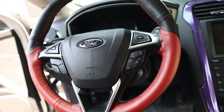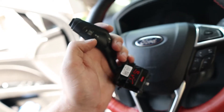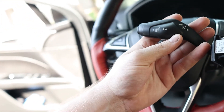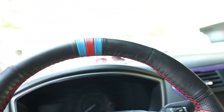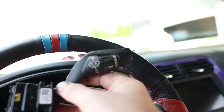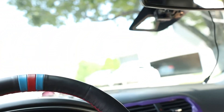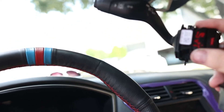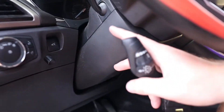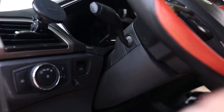The next step takes place on the driver's side. I'm going to replace the left turn signal stalk with one that has the Lane Keep Assist button on the end — that's the button used to activate it. I also have to replace the wiper stalk with one that supports automatic wipers. This came out of the same car the mirror came out of, and I had to order the Lane Keep Assist switch because someone had already taken it from that car. We have to take off the cowl piece around the steering column. There are two Torx screws for each switch and they just slide right out.